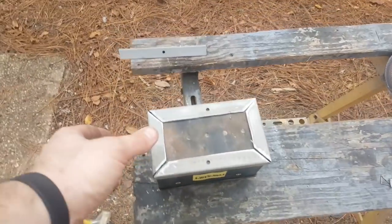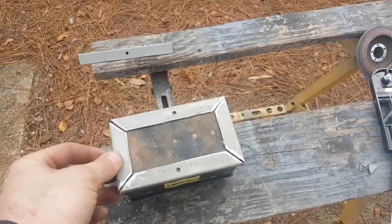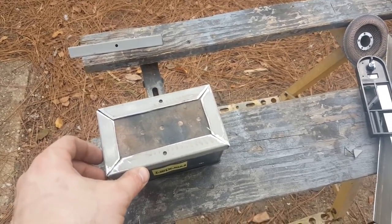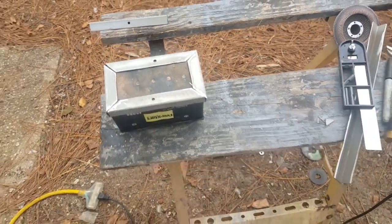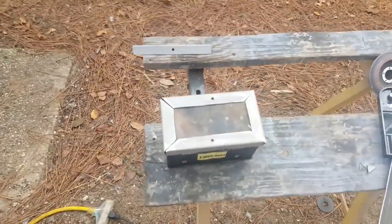Here you've got a battery that I turned upside down. I've got a bunch of pieces of angle iron — this should make the tray for the battery. I'll get this sucker welded together. All the cuts fit quite nicely; they've been mitered that way. And I'll be really careful when I weld it together that it doesn't shrink and that the battery doesn't fit into it.